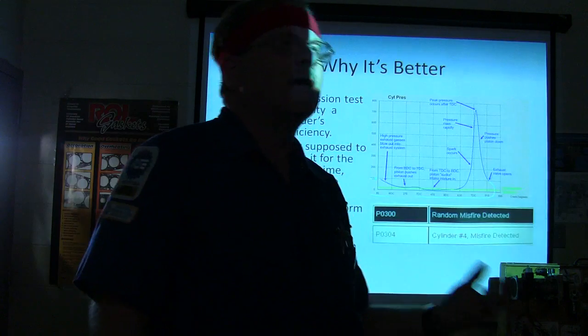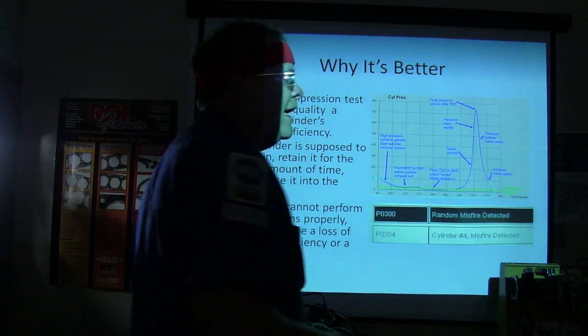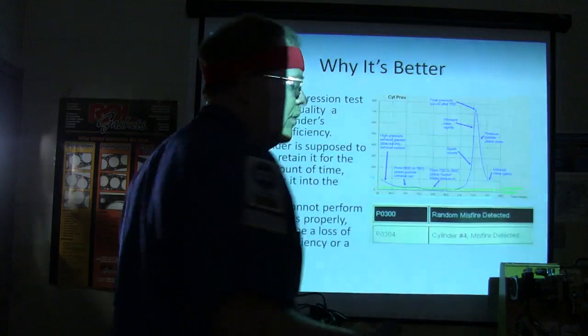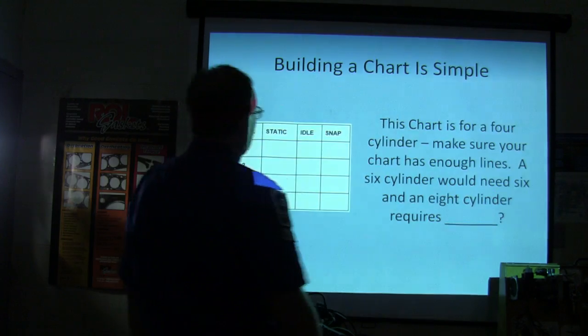You know, if the air density is different from one stroke to the next, you're liable to have a misfire, and you're liable to hear the pull, pull, pull, pull. That can also be because of spark plugs and all.